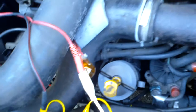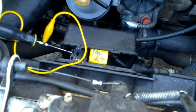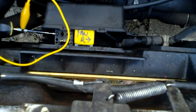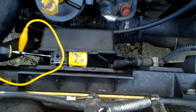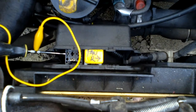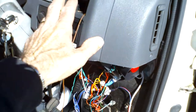So now I know the relay base is working. We've checked the coil - that's all right on the relay. We've checked the fan. The only other thing it could be if you've got a faulty fan is the switch. But it does help you save money and find out exactly what it is with nothing special except a lead and a bulb.